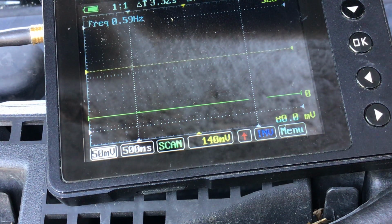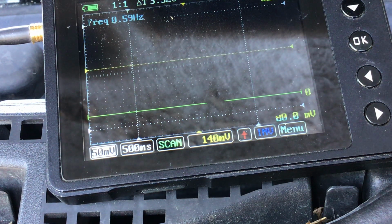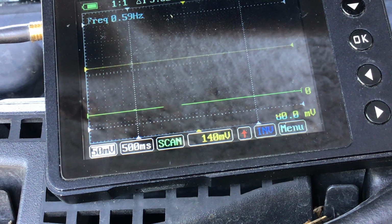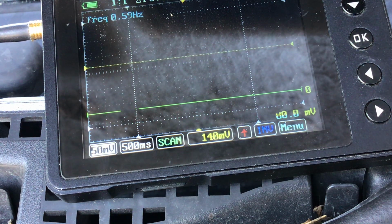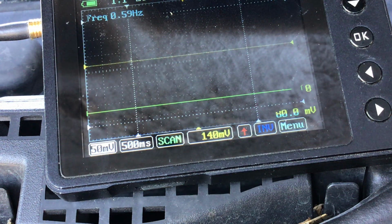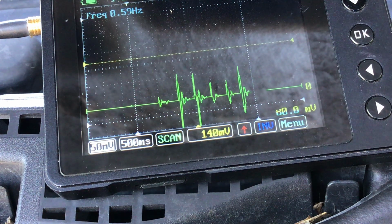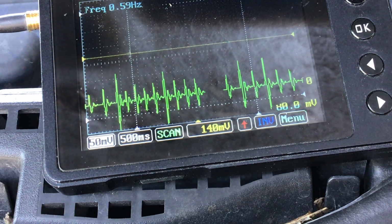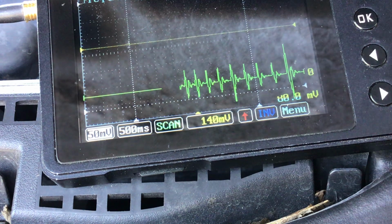That was most likely the effect of other cylinders in their strokes, in particular any other cylinder that was on its exhaust stroke with an open exhaust valve, you know what I mean. That transducer in the tailpipe will feel all the cylinders when the crank is rotating. But nonetheless, okay, there we go. Now I got an open exhaust valve. If I had a leaking exhaust valve, this is what it would look like at TDC compression. And I'm going to continue over to the intake stroke to see what that would look like, and then we're going to end this video.